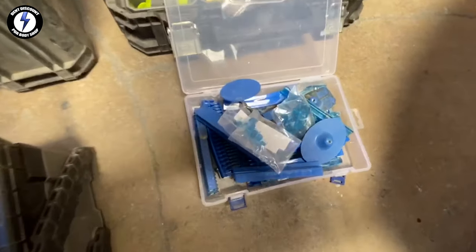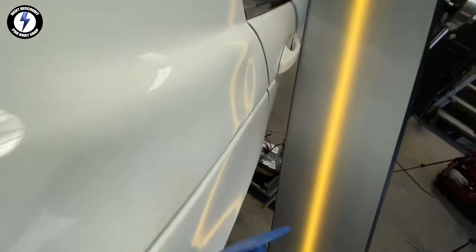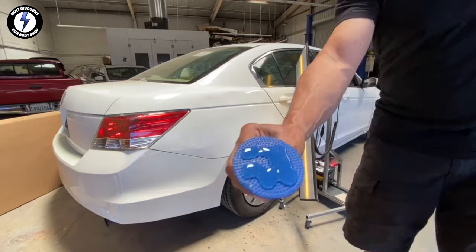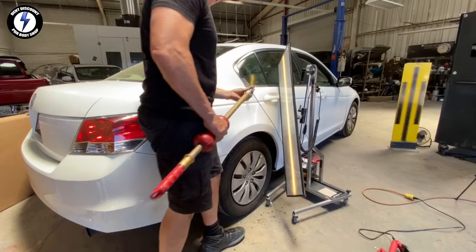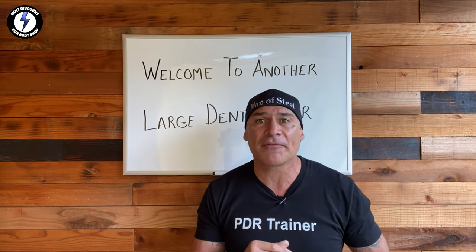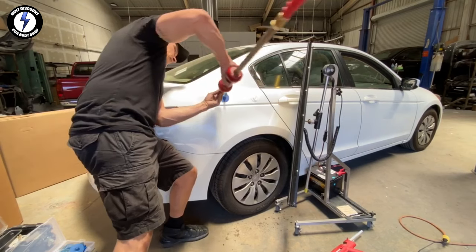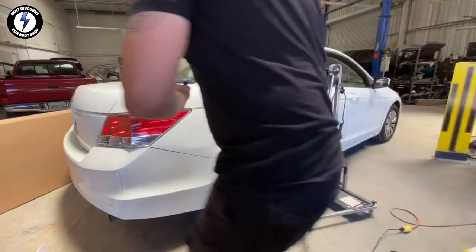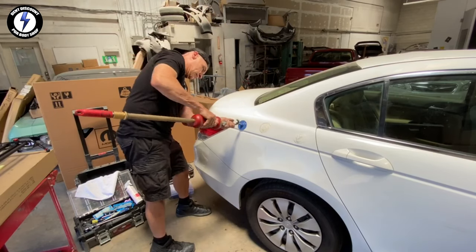Moving on to the fourth step — I'm going back to the hot glue method. This time I'm going to use a large three-inch tab. These tabs fit really nice within the dimensions of the dent. Placing the hot glue on the plastic surface of the tabs and giving the tabs a gentle push into the center of the dent. Placing the slide hammer hook through the eye bolt and giving the slide a few pulls. Tip number five: be careful not to pull too hard and overstretch the metal — pay close attention to the metal movement. I'm using my PDR light in conjunction with every pull. Placing the next tab in the shallow spot near the tail light, running the hook through the eye bolt again, giving the slide hammer another strong pull, then removing the tabs.